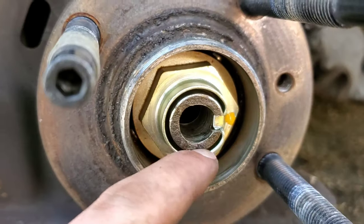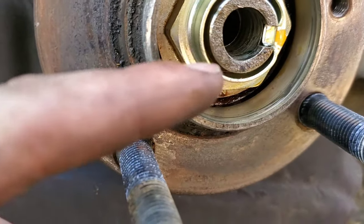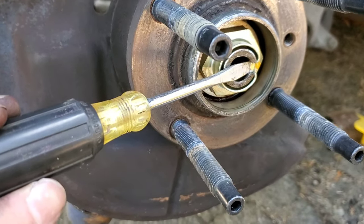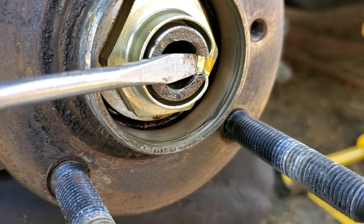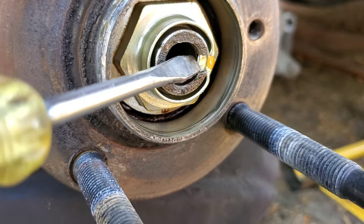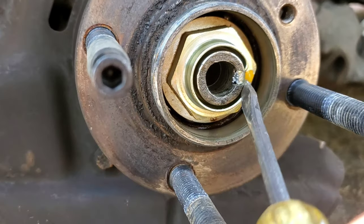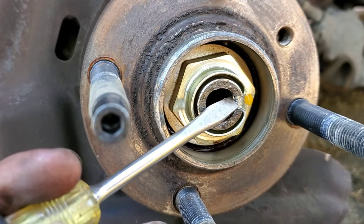And now we're at this guy. What you need is a flathead screwdriver and we're going to pry this pin and get this big ol' nut off. This is where the hammer comes into play. We're going to take our flathead and try to make as much contact with that as you can while you're tapping on it, because if you go at it with just a point you could split it. And if you're cheap like me, you want to reuse the nut. I was just tapping on this for a good minute - I'm going to try to open up this area and see if we can get our little tab to come out a little bit.